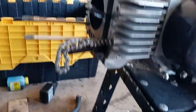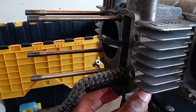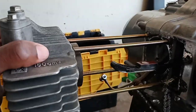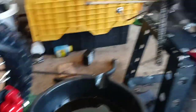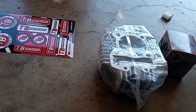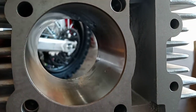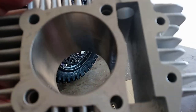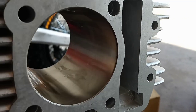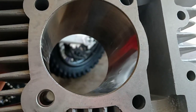I got the cylinder head off — the dress-up kit is sitting over there and all the gaskets are fine. Next is the cylinder. I went ahead and mocked this up earlier with the piston not actually installed, so everything should come off easy. I've got the chain in there; we're going to pull out the guide and this should wiggle right off. Now we have the head and cylinder off. I'm going to clean the surface up a bit. The new cylinder is already oiled and lubed nice and smooth inside — I'll add just a little more oil before installing.